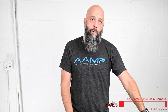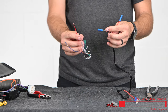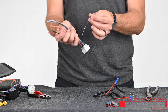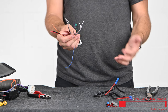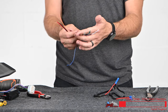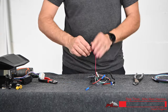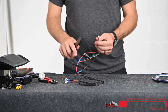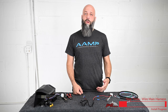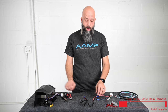Now we're ready to make our connections on the wiring harness. Our Razer dash kit comes with a two-wire harness that connects to the power distribution block in the engine bay, giving us an accessory and ground wire. In this installation we're going to use RCA connections, so we're clipping off the speaker leads so they don't short out. We're also going to connect the remote wire to turn on our amplifier. Because we're installing the switch hub, we'll connect some trigger wires to the SPX-M1's harness so we can run those through the firewall when we install the power wire.